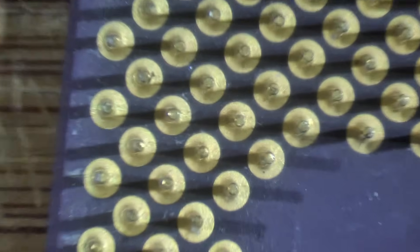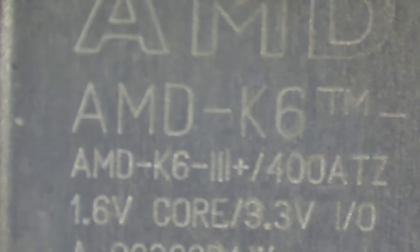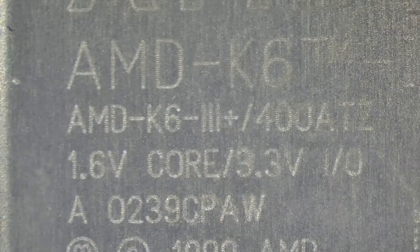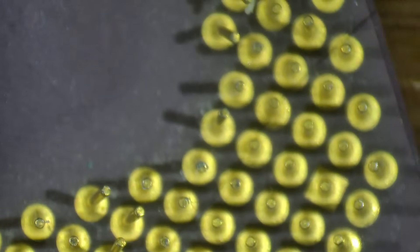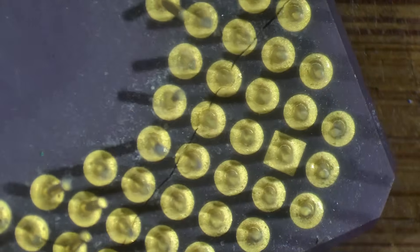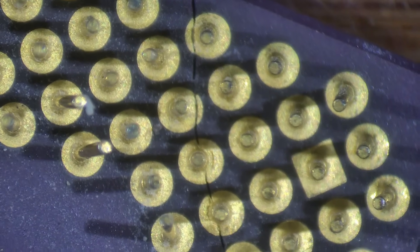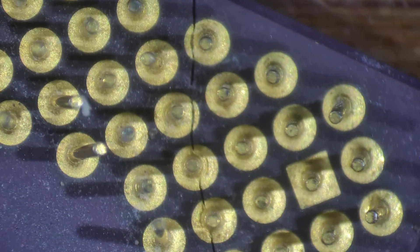Let's have a look at this one — this one looks good. This one looks actually very good. We have one more, and it is exactly the same K6-3 Plus 400 MHz, 1.6 volt core. Is the ceramic cracked? Oh no — it is. No, this chip is unfortunately dead too.